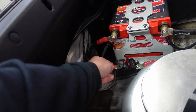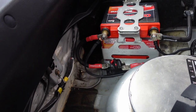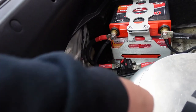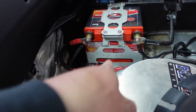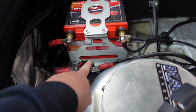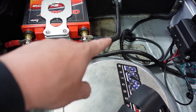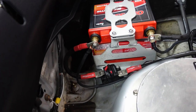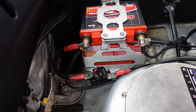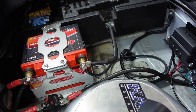I'm going to change this power — instead of being on here, that's for the fuel pumps. So even if I kill the switch, it still has power here. Terrible idea. I'm not sure why I did that. So I'm going to move that down here, or what I thought about doing is making a lug stand — running something off here with a one gauge or zero gauge wire over to a stand that has like three or four breakoffs for stuff like that instead of running everything off the studs.